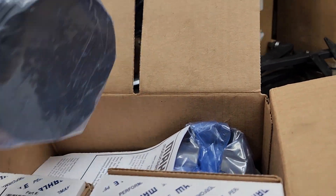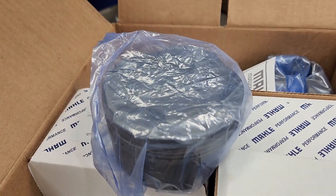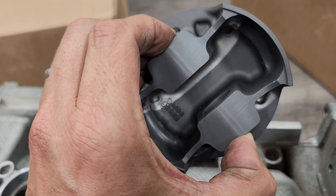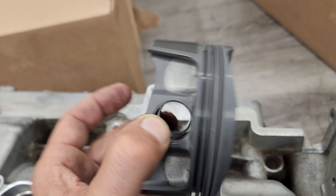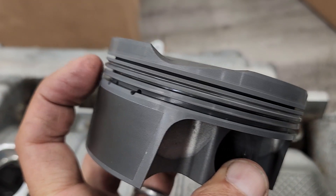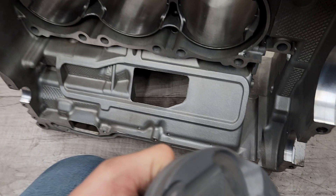So we're doing a little unboxing here. Comes with the pins, comes with a piston. We're not going to go too far out of the box. So that's the piston — 3.8 liter. It's basically a Porsche spec piston. I don't know if we can zoom in there, but it's a clean piece, coated. I don't know what the alloy is, but it's a nice piece. Oil anti-flutter groove and compression anti-flutter grooves in it. It's nice. For the price, you can't beat it. So we'll see how it runs.